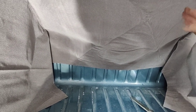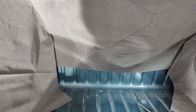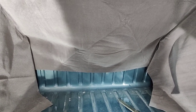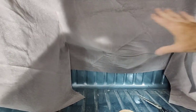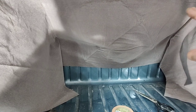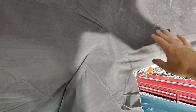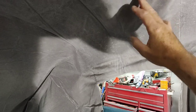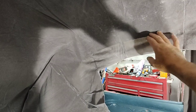Then I don't need to put the seams in, I think. That's what I'm looking at right now. You just got to keep doing stuff over and over and over. When you do one of these headliners, every one I've done, it's not about getting it right the first time. I've been stretching out these sides, and then I got a little wrinkle over here. So I'll pull that down again and just keep working them until they're gone. A little bit right here came up from playing around with something. So you got to keep reworking that glue. That's why you need really good glue.